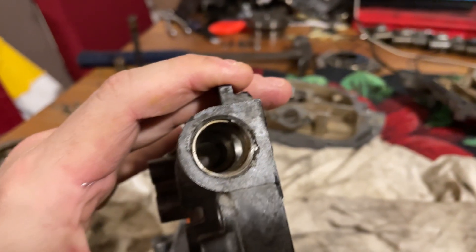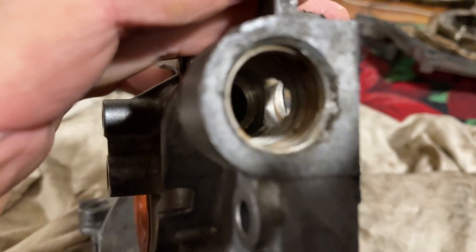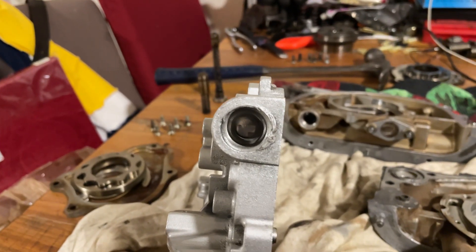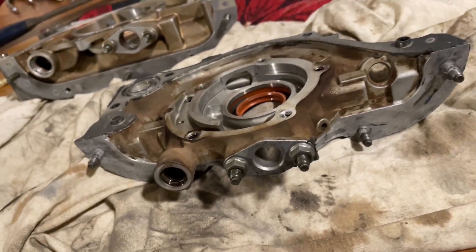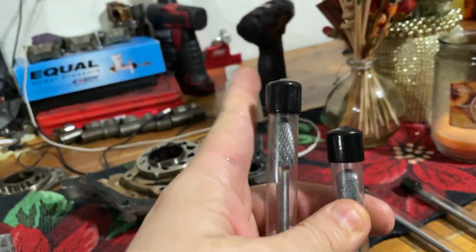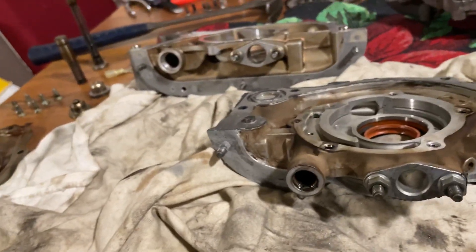You can see that big ridge right down there inside, and how that part where the opening is is bulkier and more angular compared to where I smoothed, rounded off, and opened it up. I'm trying to open it up wisely, not go crazy, because I don't want to mess with the integrity of the overall pump. Here's the bit I used to open up the tunnel, and this is the bit I used for the initial porting where the oil pushes out. This bit wouldn't even fit into the tunnel at first - I had to go with a smaller one and work my way up to the bigger one.